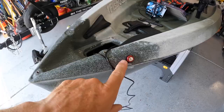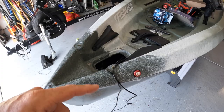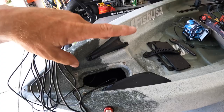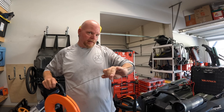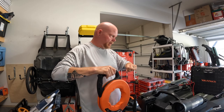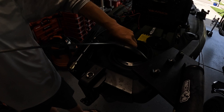The main thing is just do not over-tighten these and they'll thread into the boat very nicely. Look how nice these look — so small, just a little red and a little green. It's so cool that this is plug and play for most people who don't like to cut or splice wires. But New Canoe really needs to give a bigger access port here — the way boats are rigged today with lights, motors, and everything else. This is the snake we're using — you could use a stiffer piece of wire. We're going to send it up to the front, grab those two wires, tape it, and pull to the back hatch. We'll feed it through the hole and it'll make its way to the front.